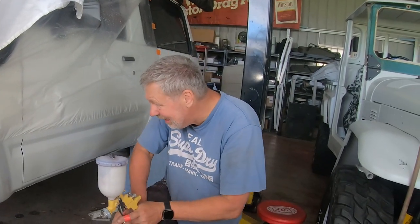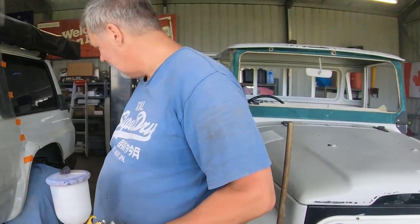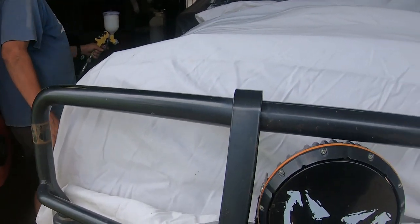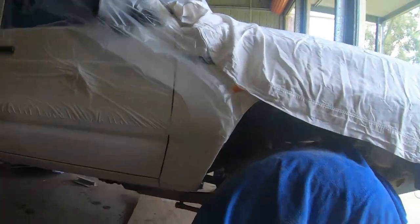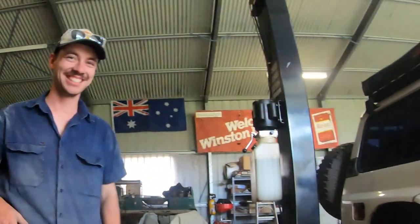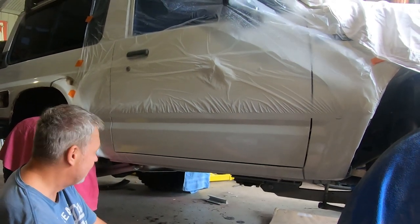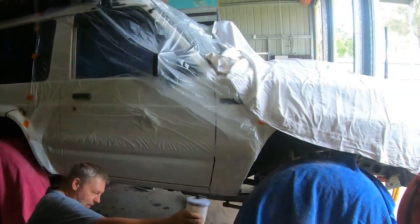How long does it take to go off? Probably 10-15 minutes, not hours. We'll go over to the other side and hit it a second time, then hit this side a second time and we'll be done. See, it's almost packed off already. That side's done — more sanding. We haven't gotten to the finesse part yet. Hakeem looks a bit too clean, and of course we've still got to bog up all of these patch panels that we've welded in. At least all the bare metal's covered with something now. We'll use what we've got left with a paintbrush and just do the top of the doors.